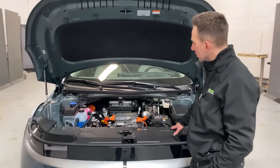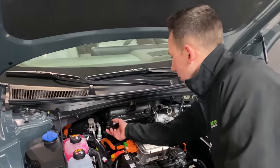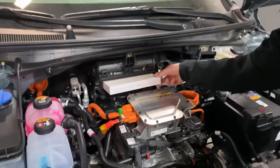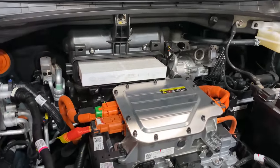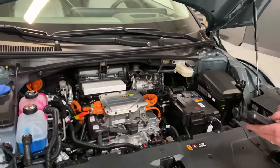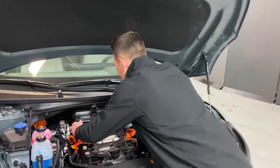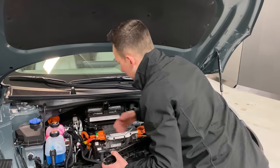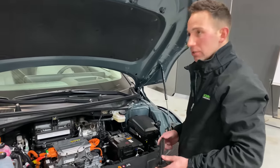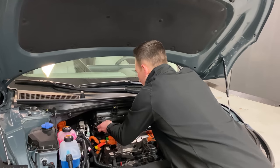Just something interesting — sort of a legacy Kia. We've seen it on other vehicles, like the Toyota Sienna had done it. This little panel right here actually exposes your cabin filter for your HVAC. On a typical HVAC system, you've got to be a contortionist to get under the dash and get to those filters for service. Kia has done you a favor and made it pretty accessible. There's always a packaging sacrifice — in this case they're eating into the underhood area a little bit. This is something we saw them do in 2016 on the Sedona and a few other vehicles.